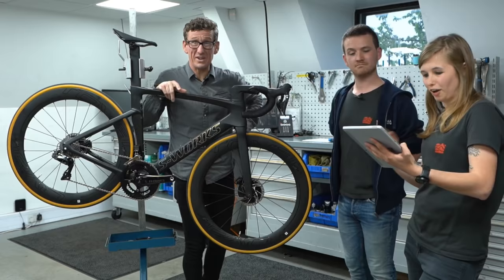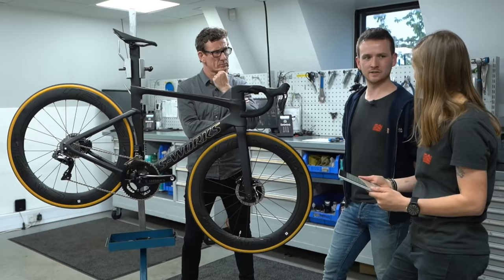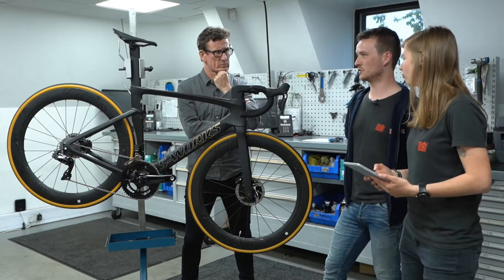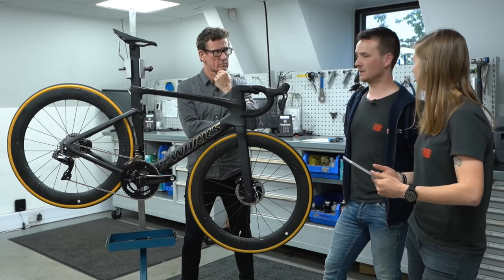George Hyde asks: is grease essential for stem and seatpost bolts? For the bolts, yes — get a good quality anti-seize. People do round them off quite easily. Alloy bolts are getting silly — replace them with stainless steel if you can. Plenty of grease on there and try to remove any Loctite. Carbon fibre paste on threads is an absolute nightmare, so keep that off the threads.